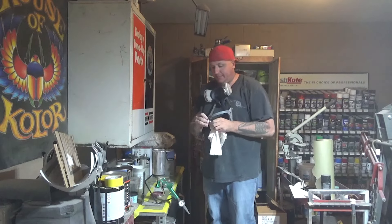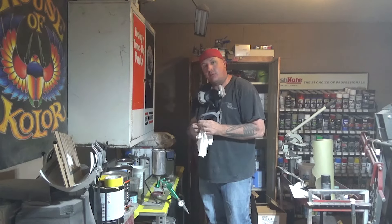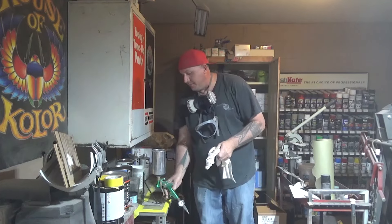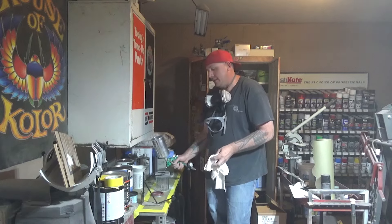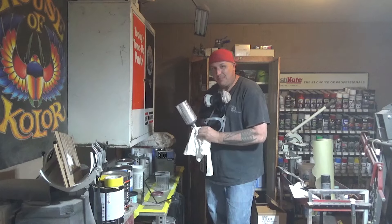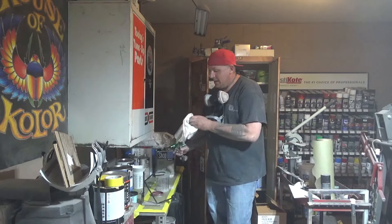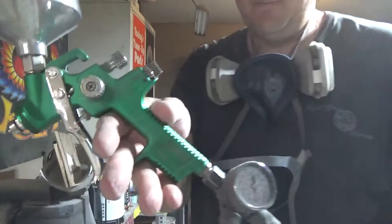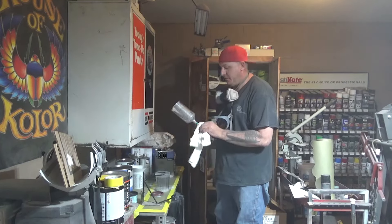So that's our primer sealer. We're going to go to color next, and you'll get to see the awesome color we're painting this '56 Chevy. For the primer sealer I use a 1.4 tip. Anybody in the know might be making fun of how old my guns are — I bought my original guns and I still have the same ones. I've replaced a couple of parts in a couple of them, but I just keep them clean. These are some SATAs, however you choose to pronounce it. That was our primer sealer, which was white because we're doing a light color here.